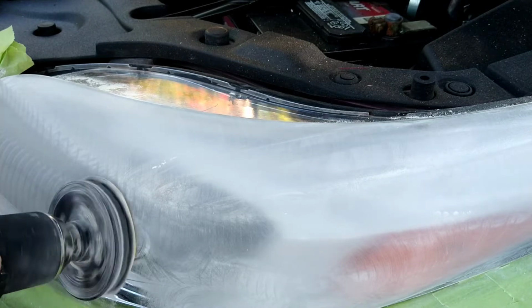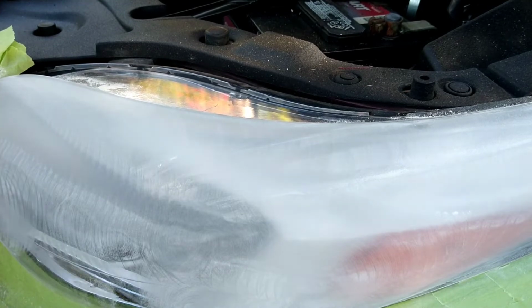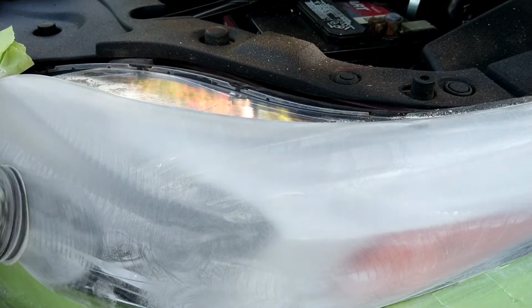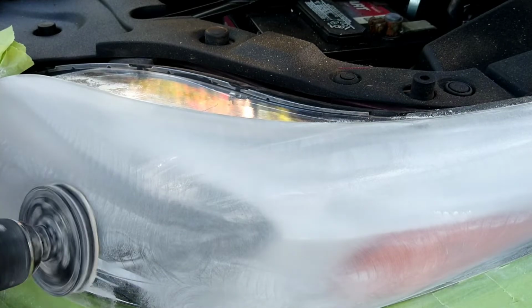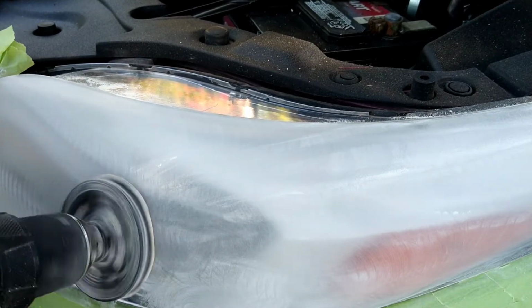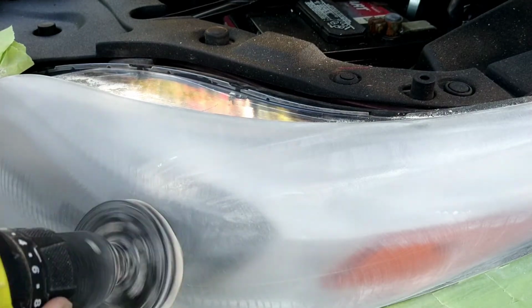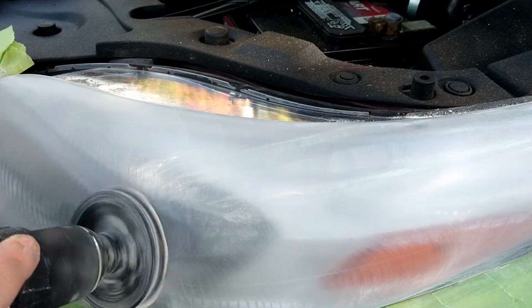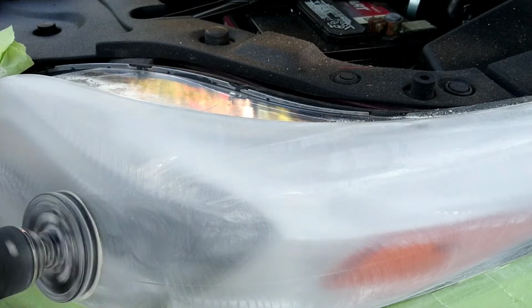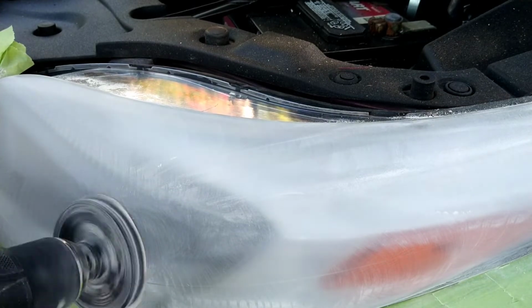Now with that top piece, you're having to remove to a certain depth and uniform and smooth out and do all these other things, versus just removing the factory clear coat on this bottom half. So it's a lot more tedious, it takes a lot more skill, takes a lot more time. That's why you want to start with that. And this way you can just uniform everything together with the top. And as you see, the bottom half here, even though it's bigger, takes a quarter of the time as those top halves or those damaged areas, whichever light it is.